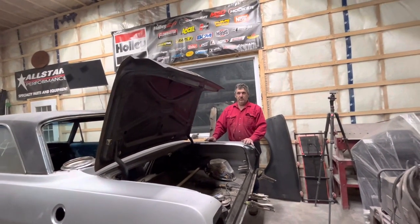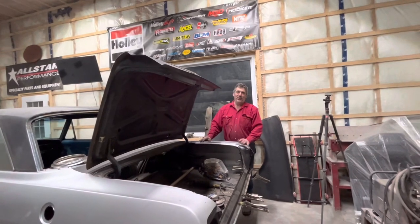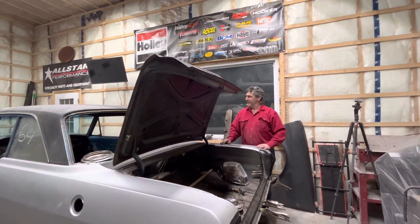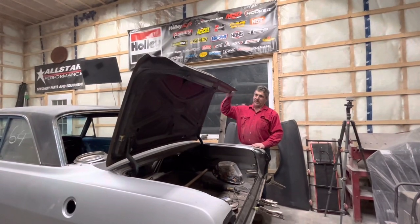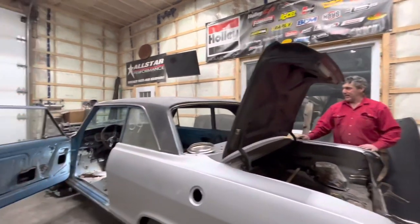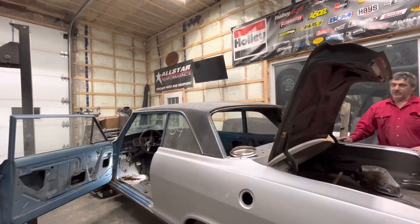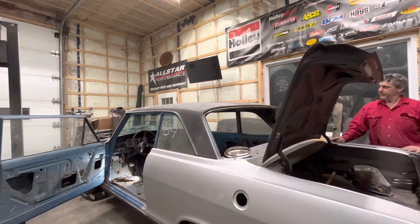So what's the estimate on pulling the engine — do we do it in one night? We can do it one night, but probably not tonight. I may just make John do it tomorrow. I got four beers saying we can do it tonight. By the time you get done with that interior, I think we're going to work on getting the windshield out and getting that dash out of it. I'll start pulling parts off the engine, but then I'm going to have to jack it up and get under it and loosen a bunch of stuff, and you're going to be doing the dash and we'll be in each other's way. So I'll try to get the upper front stuff ready to pull. You can't take the actual steel dash out — it's welded in — but you can take all the components off. Then we can probably finish stripping the wiring, because once the dash is out the wiring can go. So that part's done and then we'll just have a little bit of engine pull work left to do. Won't be bad.